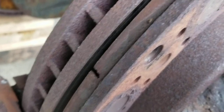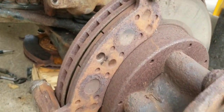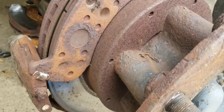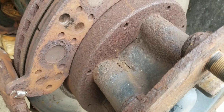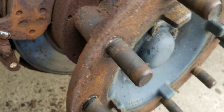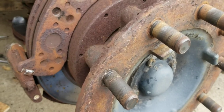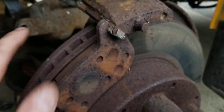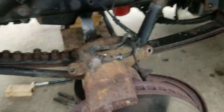We're going to put on new brakes and new rotors, clean the bearings, repack them with grease, and put new seals in. The seals go on the back side of this hub, and as I showed, those five bolts hold the rotor on — you can see the bolts coming in this way. They were actually tighter than the lug nuts, mainly because you only have five here versus ten lug nuts. I just need to get this all taken apart so when the new rotors and brakes arrive I can slap everything on. You've got to get all this scaly rust off and clean this all up so you don't get rust stuck in the places you really don't want.